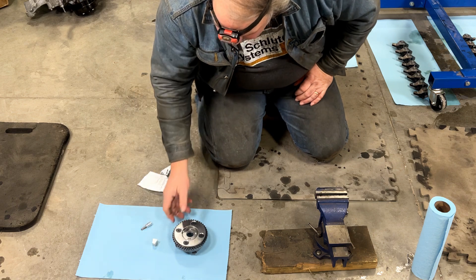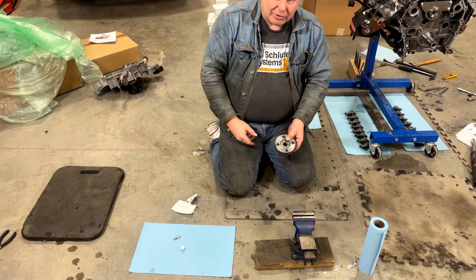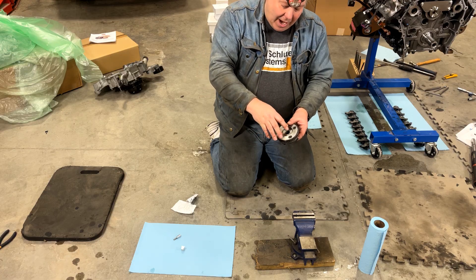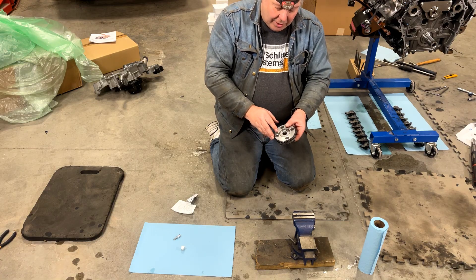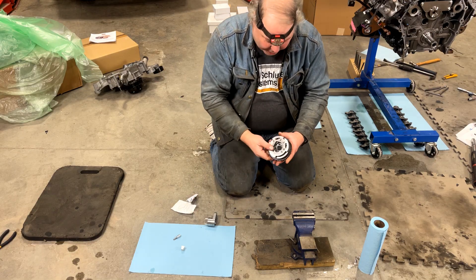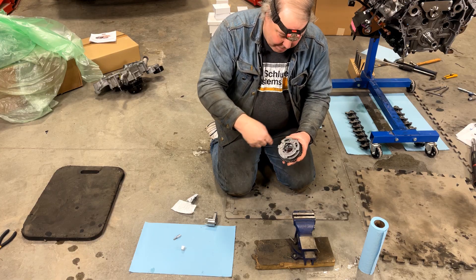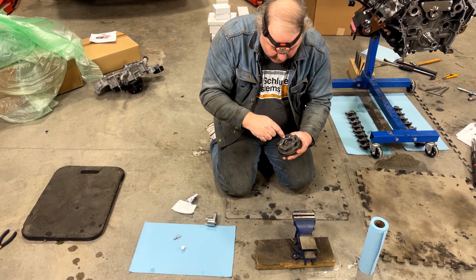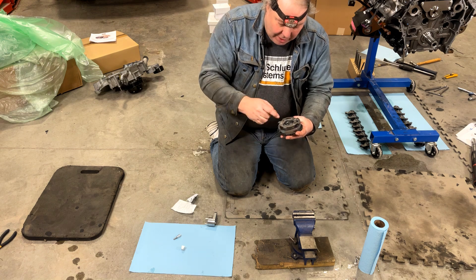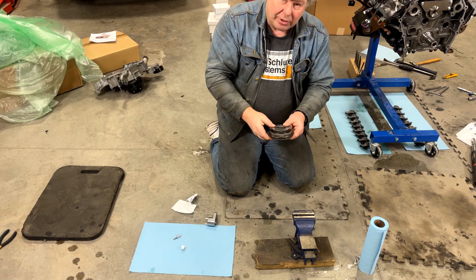In order to put that in there, we have to take it apart. It's not really a Ford procedure to service this part, so we're playing this a little bit by ear. The phaser halves are held together with these four bolts. Two of these bolts are long — this one and this one. One of them hooks to the end of the big spring system in there, and one of them kind of sticks in between coils of this spring. The other two are short — these two — and they just bolt the cover on.